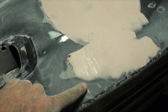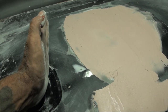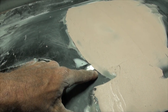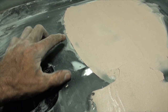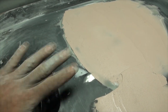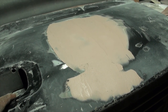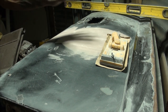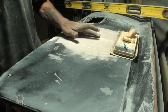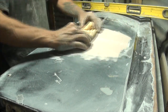I've brought all our dents together with one skim coat of red body filler, and I've brought it out over the paint intentionally - because I'm going to be sanding this area and I want to protect the primer with a thin layer of body filler so I don't keep enlarging my bare metal area. I'll sand this down, which works towards feathering the edge of the body filler with the primer underneath. Now I'm going to scarify the surface to remove the shine. I can see where the high spots are - they're ridges in the body filler - and I'm only doing those.